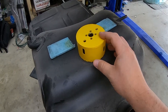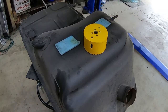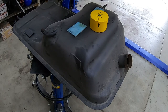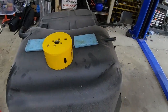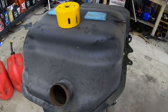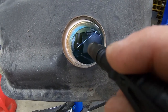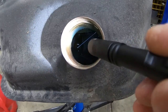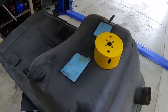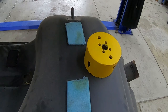This is the three-and-a-quarter-inch hole saw that the installation kit calls for, and as we can see it's actually not that big. I want it in the taller part of the tank, both because I want the depth and because this is where the original pickup is and kind of where the baffling supports getting fuel. One thing I have to contend with is where the level sender is — in this car it's basically just a float on a little stainless steel rod that goes deeper into the tank and tells you how much fuel is there. I don't want to impede that float's ability to go up and down. Fortunately this is small enough that it seems to run to the side, so as long as I don't pin it to the ground with the mat at the bottom of the filter I should be fine.